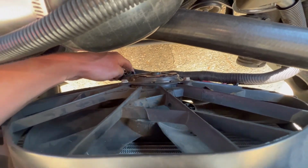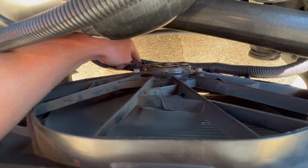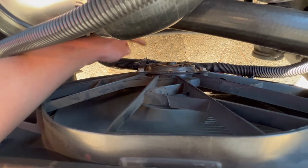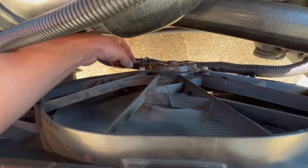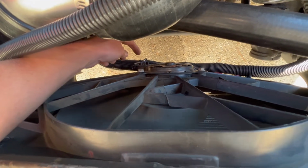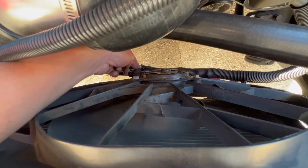Now you can see, plug it in. We see how I can jiggle it? Watch. It's still plugged in, but I just put some pressure on it. You see, it's in and not working. So I can move it. So our issue is the connector. So let's figure out how to make this more permanent to get it by.